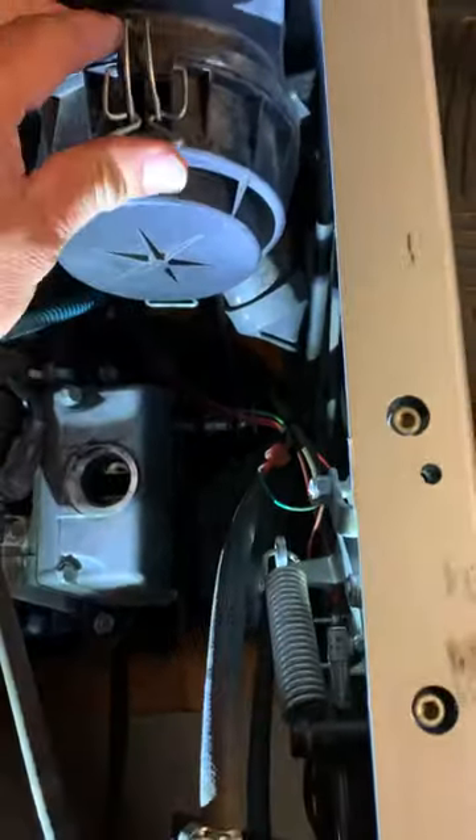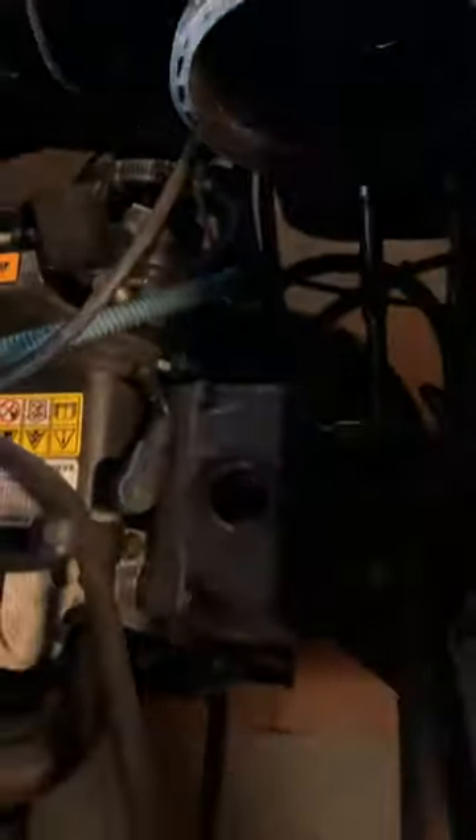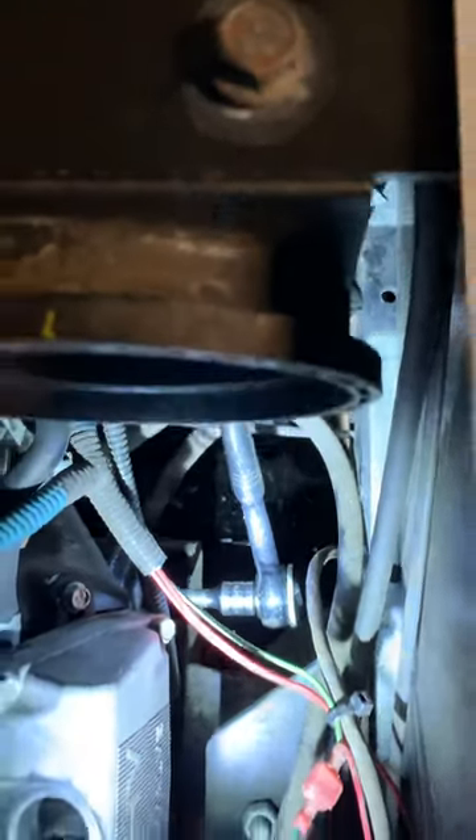This is the first time I've done this, but notice you just take this air filter cover off, pull your air filter out. You can get one of the socket-type oil filter wrenches that slides on the oil filter — you can put that on the end of the oil filter from the top with a three-inch extension and a three-eighths ratchet, and you're good. It took me just a couple minutes to figure it out.